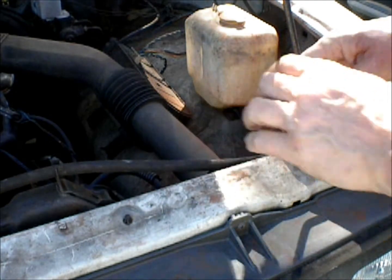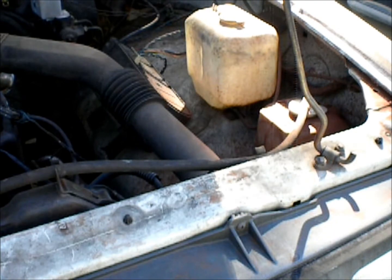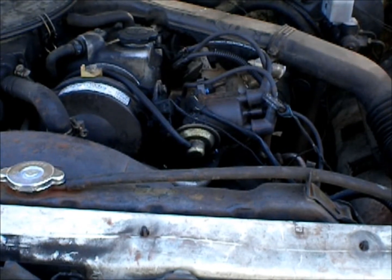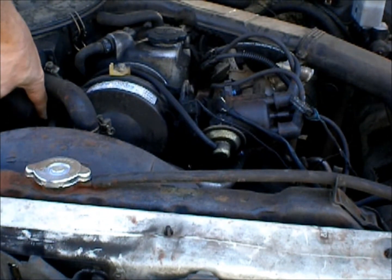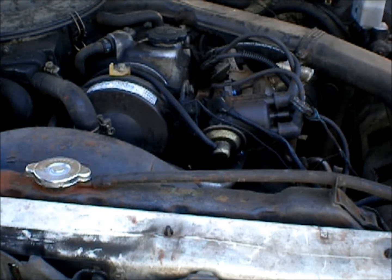At any rate, I'm not sure why it overheated. I think the thermostat in the upper radiator hose got stuck. I've pulled that out and examined it, and it does look sticky. I'm not putting it back. I have bought a replacement and an extra gasket, but I have put everything back together without a thermostat. You can't really see the thermostat housing — it's right down in here. This is a 30-year-old Mazda, and the way a lot of these vehicles are built, the thermostat is a separate part that goes in between two metal parts, and therefore for it to actually be there is not entirely necessary.